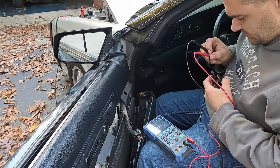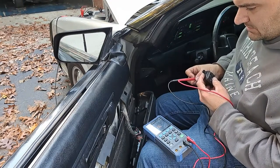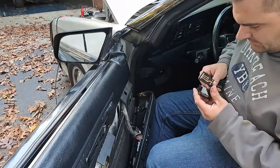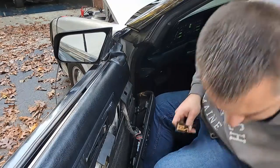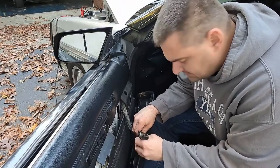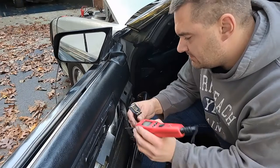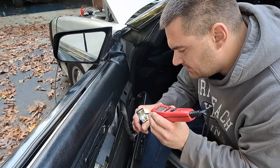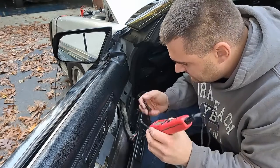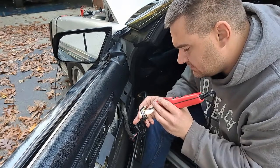That'd be the clutch. Blue, which is the motor, is intermittent. So blue, so this guy, is intermittent when it comes to power. See if we can see that with the power probe. See, I got power. I'm pushing down on it. Power there.